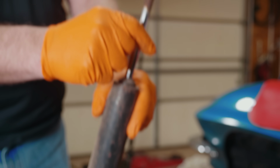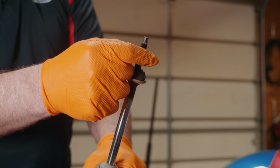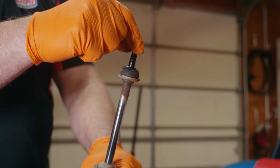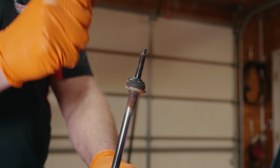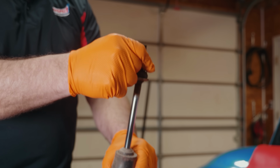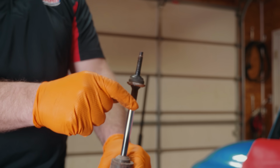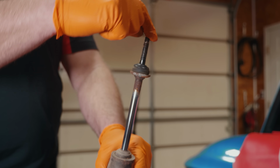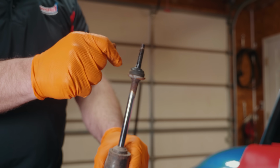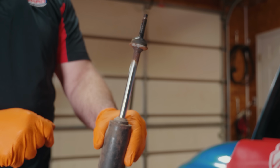Another little tip, when you're pulling these shocks out, this came apart real easily. Normally those nuts on something that's rusty do not come off that simple. What you can do, take a 9/16 long socket, take the longest extension you have, and you can just work the thing back and forth and you literally can snap the threads off the shock and then everything will just come out the bottom. It just makes your life a little bit easier rather than fighting, trying to hold the shaft, break the nut loose, all that kind of stuff. You literally can go back and forth about 20 times and you'll snap through the threads on the shaft and then you can drop the shock right out.